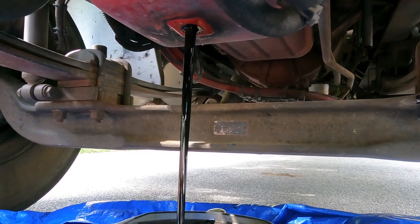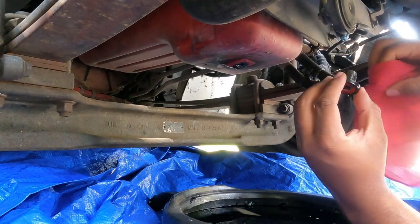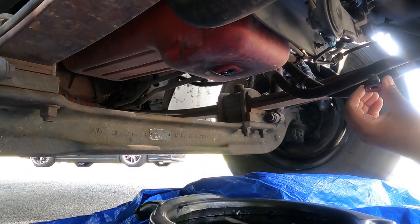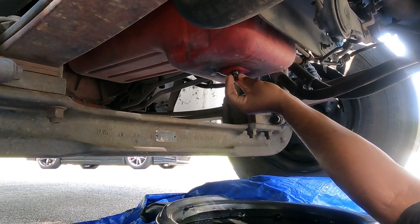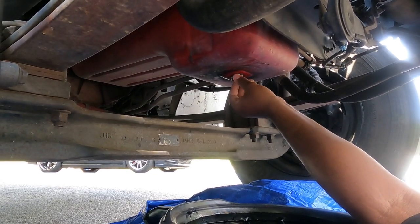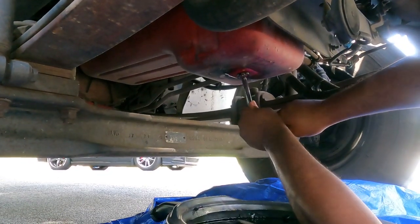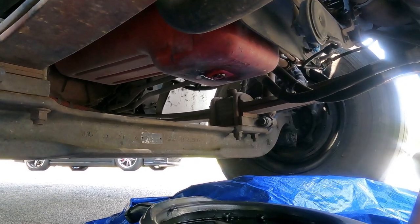Change of plans - we're gonna go ahead and finish up down here while we're here. I went ahead and cleaned up the oil pan plug, didn't see any metal or nothing, so that's good. Still dripping a little bit, but you'll be here all day if you try to wait. Go ahead and do a quick wipe - make sure you're not cross-threading. You want to tighten it by hand first so you don't cross-thread it. Go as tight as you can with your hand first, then snug it up. Don't over-tighten it. Just snug. Always double check.